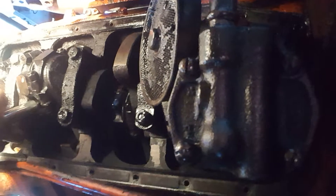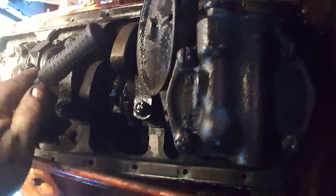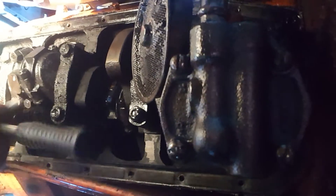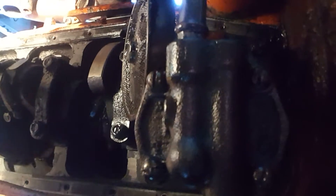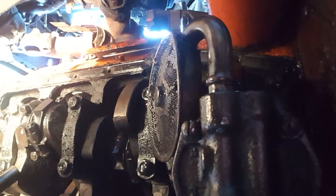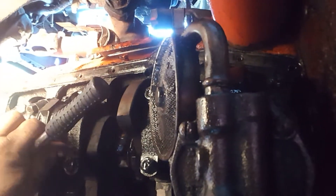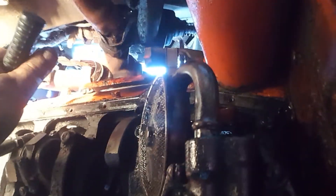I think this is all I'm going to do for today. Maybe I'll put four of the nuts for the oil pan on just to keep any dirt out of here. Yeah, they don't have to be torqued much more than that — you can see by the other connecting rod that they're not torqued too far down.